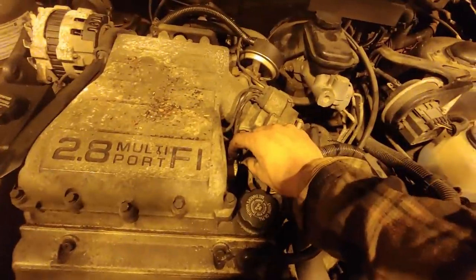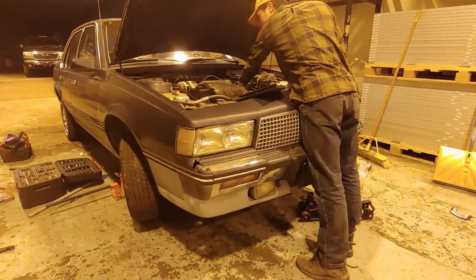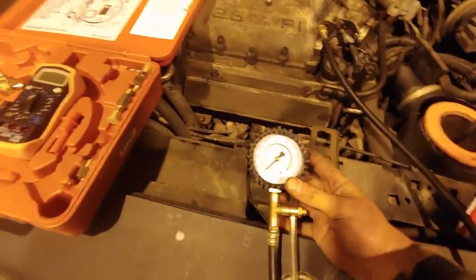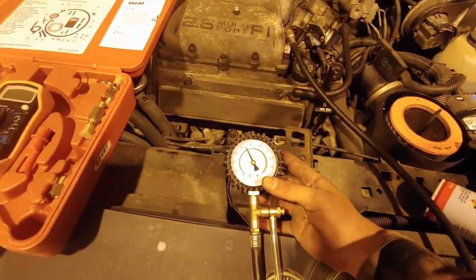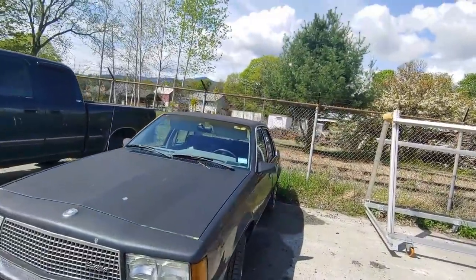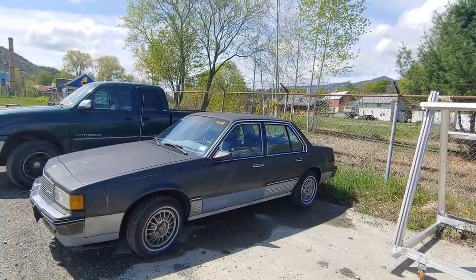You can hear the fuel pump going. Let's check our pressure — I don't have a PSI meter at the rail, but we're getting some pressure there, so it could be the injectors. I got the fuel pressure gauge lined up. Jeb, turn it to prime — wow, okay, try to start it. We actually have good fuel pressure. So with the Cimarron having good fuel pressure, I think I'm gonna start with the injectors: ohm them out, see if any are shorted or gummed up. We're gonna tackle that in the next video.